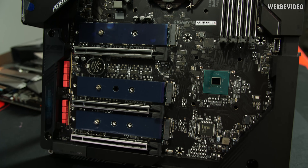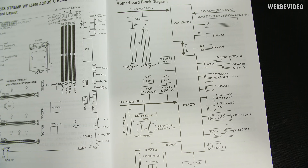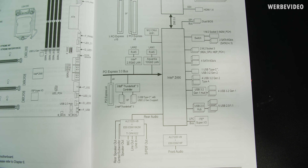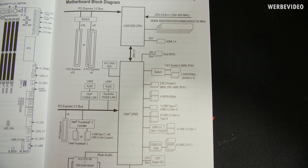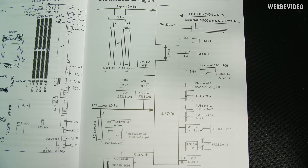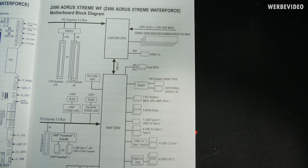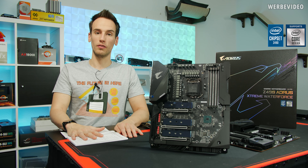You can also spot multiple M.2 slots, and the first one is marked 'M.2 CPU'. I first thought this one would be connected to the CPU. However, looking into the manual — shout out to Gigabyte for providing a beautiful block chart — it's always perfect to have those block charts because you get a perfect overview of which device is sharing lanes with which slot. Looking at the block chart, M.2 CPU and M.2 PCH are directly connected to the Z490 chipset, so you would not lose CPU lanes if you populate the top M.2 slot. There is also a switch that swaps the M.2 PCH slot with some SATA ports, so populating that one will cost you some SATA connectors. Very nice work from Gigabyte for providing those block charts.